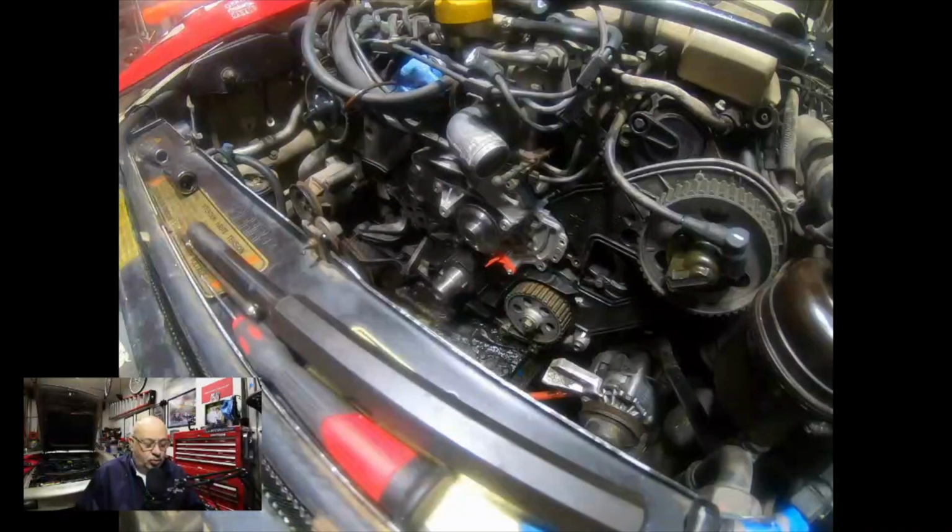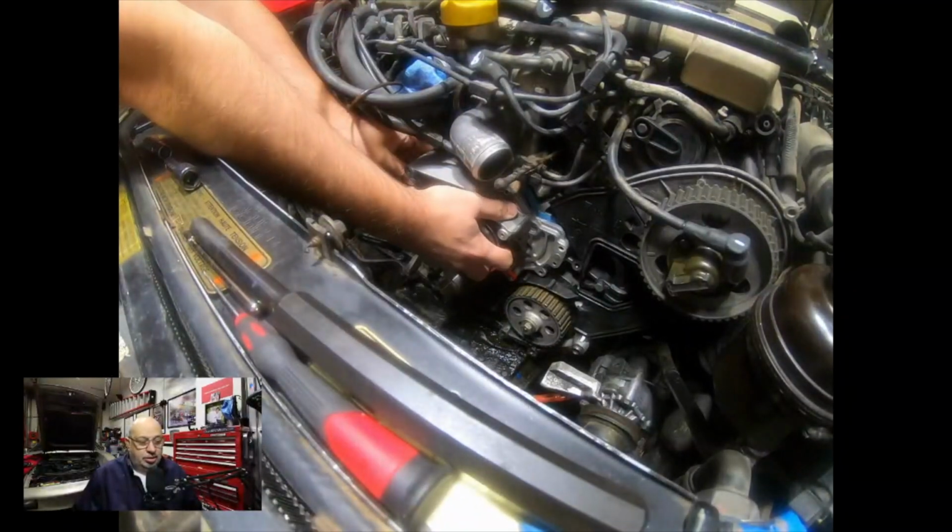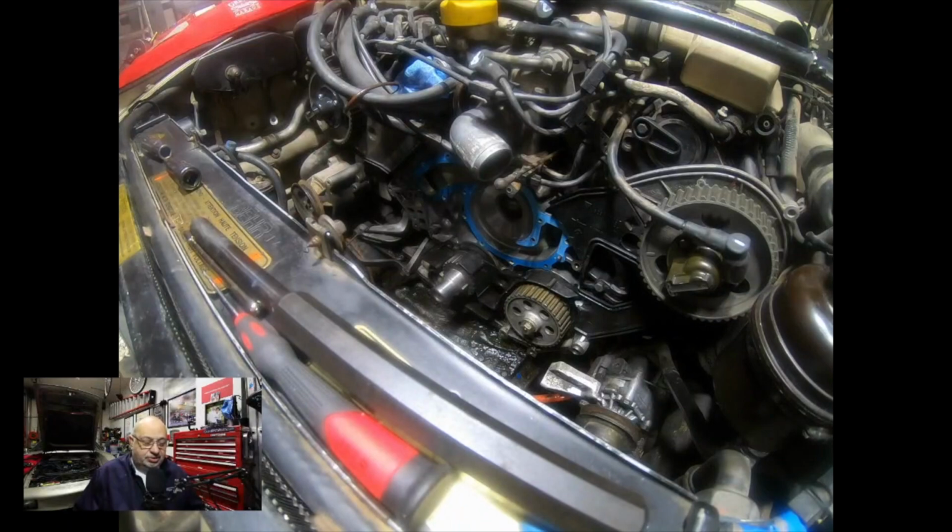There's a still shot of the new water pump in place. We had already gone through the laborious exercise of putting in 12 of the 13 bolts. Unfortunately, the one I just showed you would not go in, and we basically called it quits the one night when we did that. So here we are, pulling it from the right place, and luckily it sits on there with two guide pins. Our first theory was that the bolt that would not go in, we somehow stripped the threads pulling out the old bolts. We saw a lot of comments when we were setting up for this that a lot of people run into problems with bolts breaking and stripping.